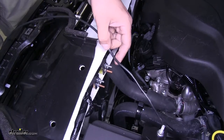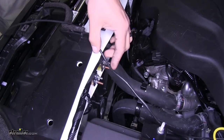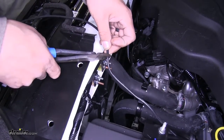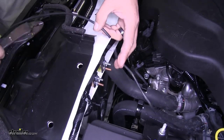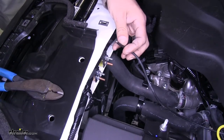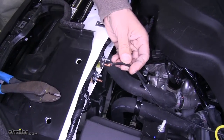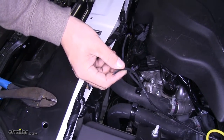Route your black wire from the back up to the 40 amp breaker and estimate about how much wire you're going to need to attach it. It's never a bad idea to give yourself a little bit of excess. Cut the wire and hold on to the excess wire because we'll be using that later. Strip back the end and take one of the small ring terminals provided in our kit and crimp it in place.